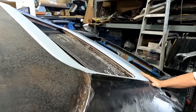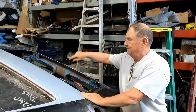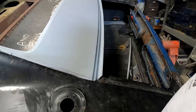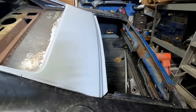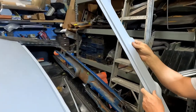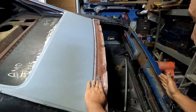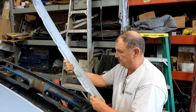All right. Once this is in, then we take our trunk deck, and we've got a trunk deck to cut off, which looks like maybe even a curve. And then you've got the other panel. I think that's what they said was the difference between the Vega windows and the Charger windows. The Charger has this curve to the bottom of it. The people that put Vega plugs in there, it's just a straight line. This goes on the bottom. Oh, it's already curved for you. This sits right there. That's the front edge, after you cut your trunk deck. Yeah, they give you this piece. Janik does. And I think this pretty much panel bonds to it.